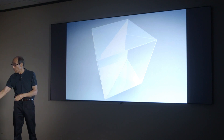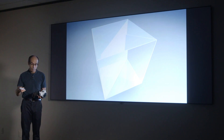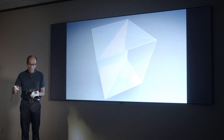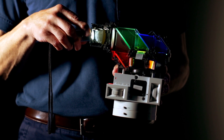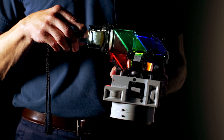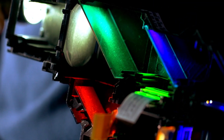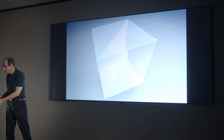Here's a typical light engine from a projector. Up front is where the lens is located — the projection lenses that amplify the image and make it big. And here on this end is where the lamp goes. White light comes out, is separated by these mirror filters, the light strikes the three chips, and you get a beautiful, realistic image formed. I have an animation here which will show you how this works.